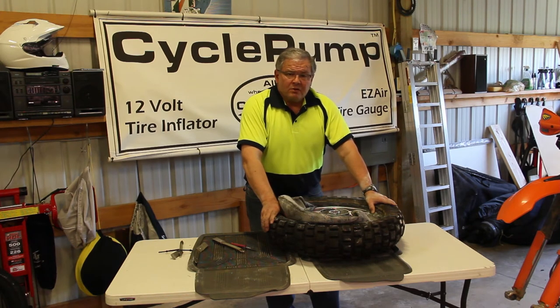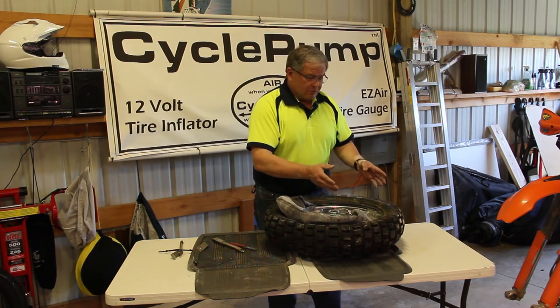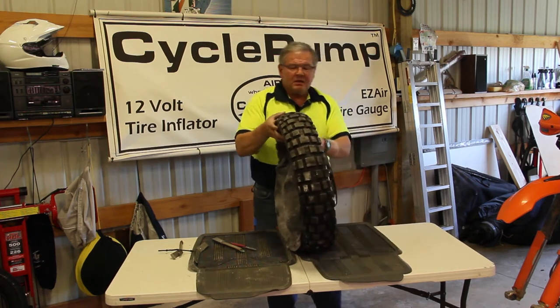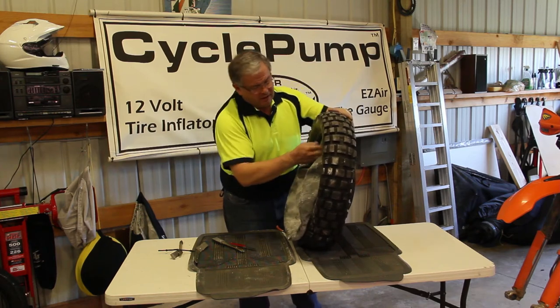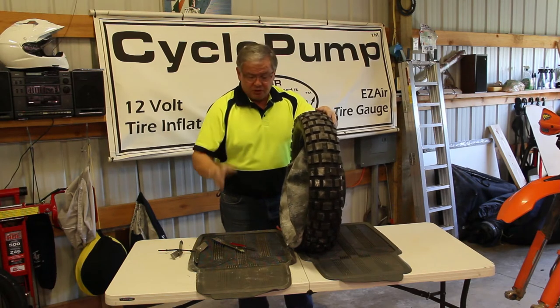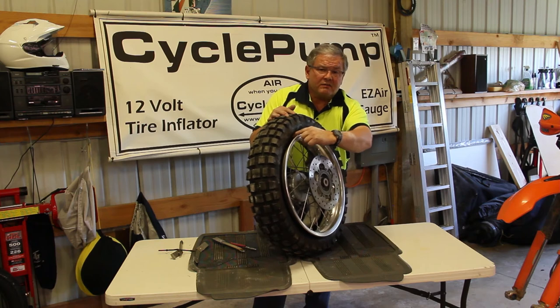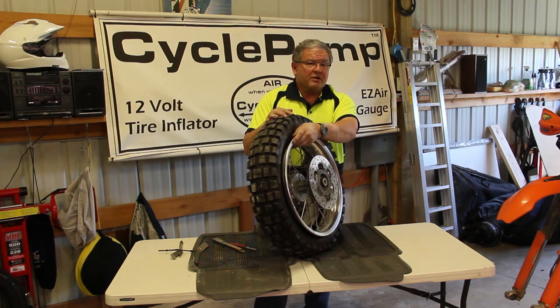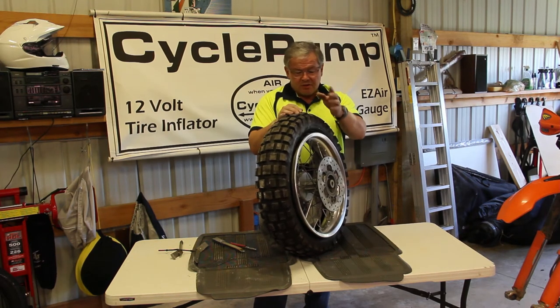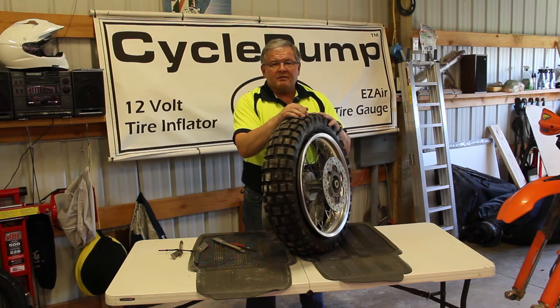Again, if you want to see how to change tires, go to our YouTube channel, Best Rest Products, and watch the videos — I've made one myself, Tracy Jeffries has made one. You can pretty much learn everything you need to know about changing tires from watching those. If you're going to take the tube out, you may be able to just push up on the valve stem after you've removed the nut, but you may need the bead spreader again because as soon as you try to push the valve stem up, it may be hitting on the inside of the tire sidewall. So that was the wide tire — pretty easy. Now we're going to do the narrow tire which has a slightly different technique.